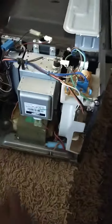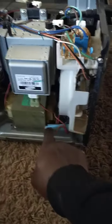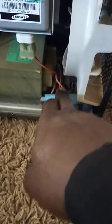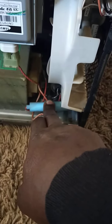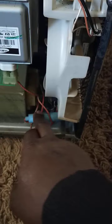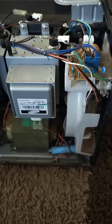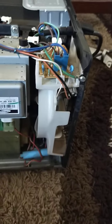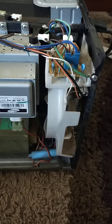When you open the microwave, this is how it looks inside. We have the transformer here, and most of the time the fuse blows. Apart from the fuse, we have the capacitor and on the capacitor we have the diode. Common things we look at: the fuse, check if the magnetron is okay, check the diode — that black small thing there. If those don't work, then we have to look at the transformer.